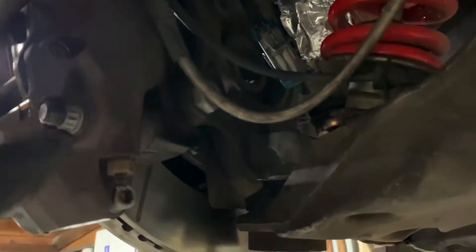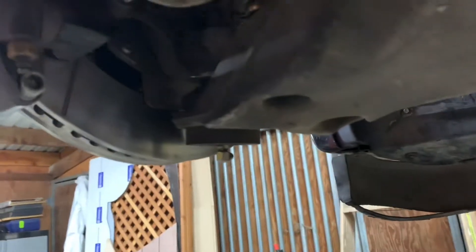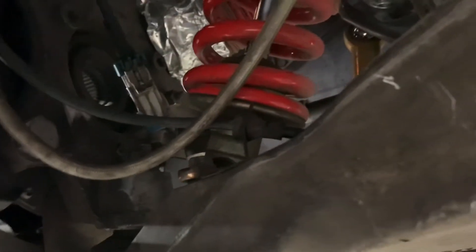As it turns out, I was actually the source of the problem. When I was replacing my rotors — you can see they're brand new here — I had to pull the caliper off to do that, and I managed to pinch the pigtail that connects from the hub back to the cradle. That was actually the source of it, but I didn't find that right away, so I had to look up the specs on the sensor to figure out what was going on.